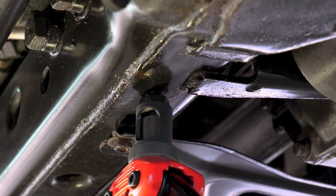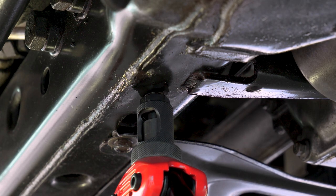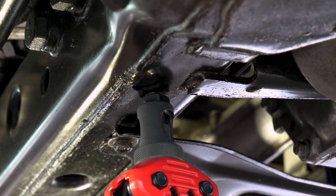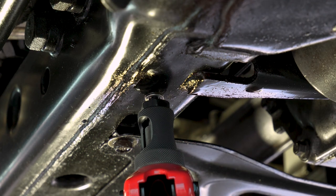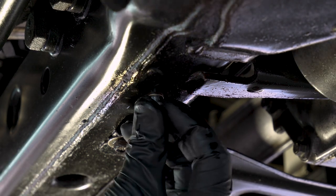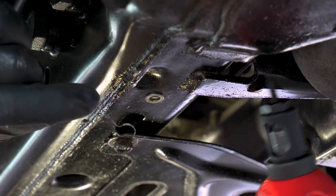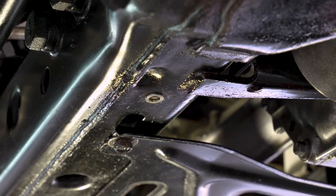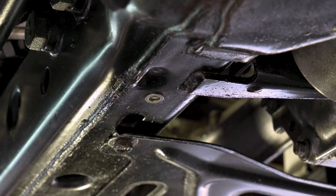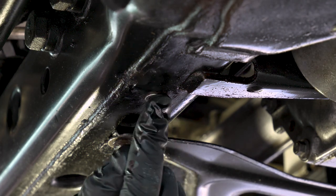Let's squeeze it on here. It's really fun working overhead with this — let me see if I can dislocate a shoulder. So that snapping sound was actually not good. I broke the threads — look at that. It was a little too strong. My stroke length, based on how much I had to crush it, was probably way too long. I just forced it, which is kind of my style, but this is what happens. So now I need to re-drill it.